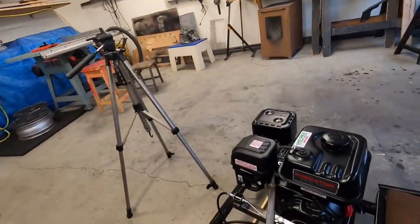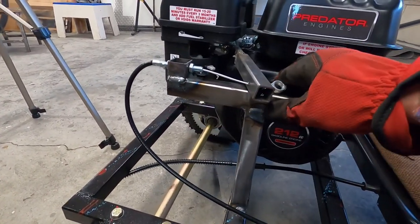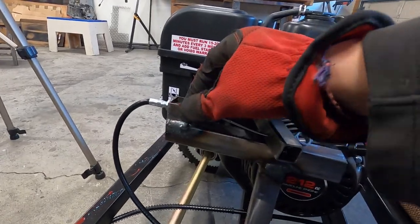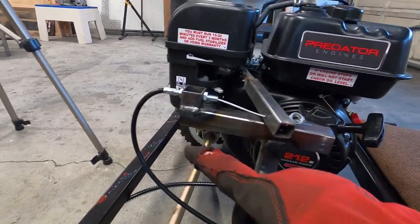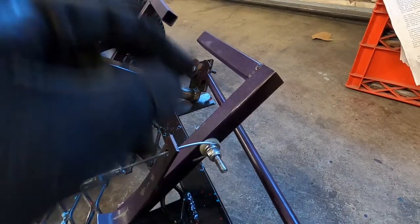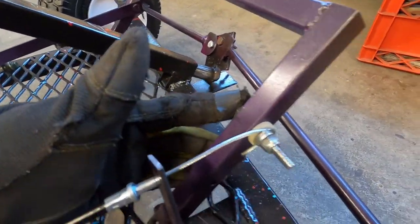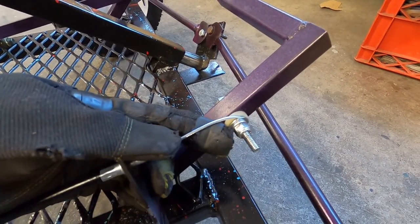Dad, you are gonna love this whole setup. It'll be consistent but it's definitely not the right way to do it. So starting from the back — I welded this T-shaped figure on, so it's solid. The throttle cable comes in through here, it bolts on to this little extra piece right here, and it's just a hole drilled through. When you pull the throttle cable you need the gas — okay, I've got a cable up here, this one's good. I couldn't figure out how to attach just the cable, so it's literally just a bolt running through with some washers, and the cable is pinched in between the washers. It's not going anywhere because it's got a lock washer and a locking nut.